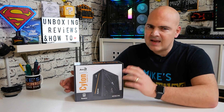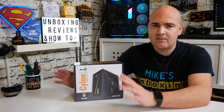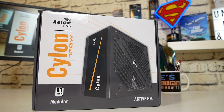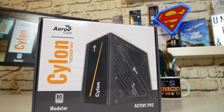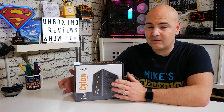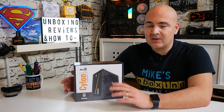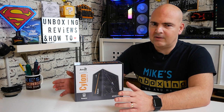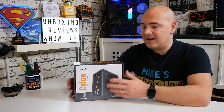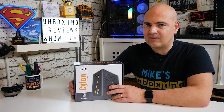When we're talking about power supplies and their ratings, what we're really interested in is the 12 volt rail, because that's the one that does the most work. When looking at the specs, take into consideration what the 12 volt rail is doing, regardless of the number on the box — whether it says 700, 800, or 600 watts. Warranty is also a really good thing to look at, but don't be put off by the brand.